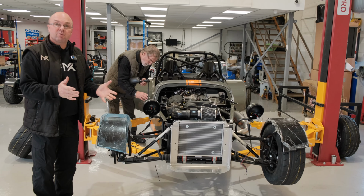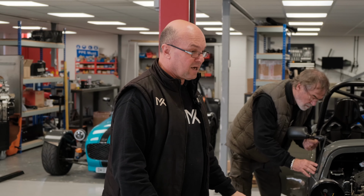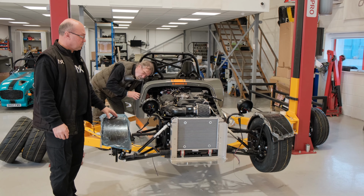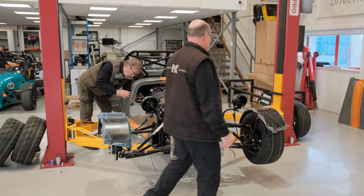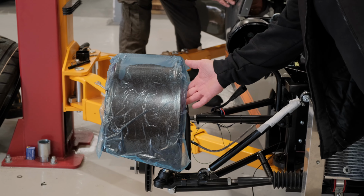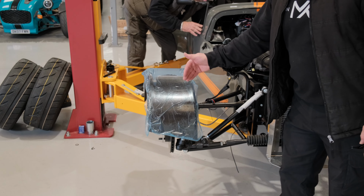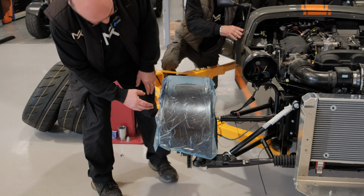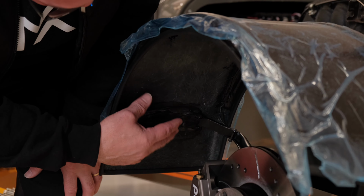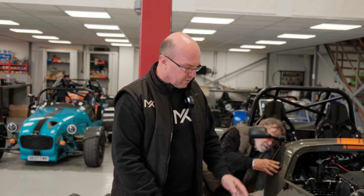So you've been following this, probably you've subscribed, you can see where we're going, and the car is cracking on and moving forward. It's come out of the bay and now onto the four post. It was just easier for us to work on the vehicle here because of some of the jobs that we've been doing, which is wing stays all bent up and bonded on. It's a two-part method. I think we showed that the other week. It's a bond on and then a seal from underneath. You can probably see just through here, Lewis, we bonded on just under here. So we do a first bond, leave that overnight, and then we go in with a second one, which was the Fairy Liquid on the fingers or the glove, and smooth it over.